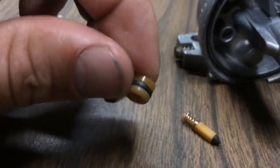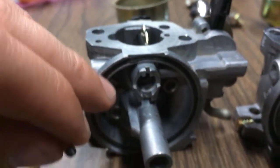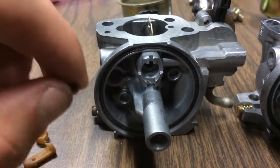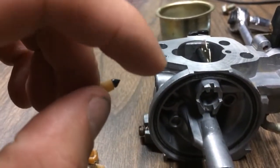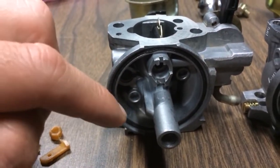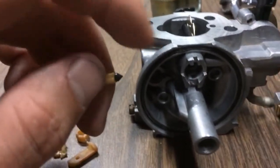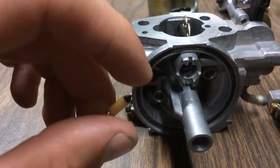There's an O-ring on here. Usually when you have a gas leak, or fuel overflowing and won't stop dumping out fuel, it's usually your needle or your float. It's usually your float is stuck or full of fuel because it's cracked, or it's your needle and you replace your needle because it's not seating properly.